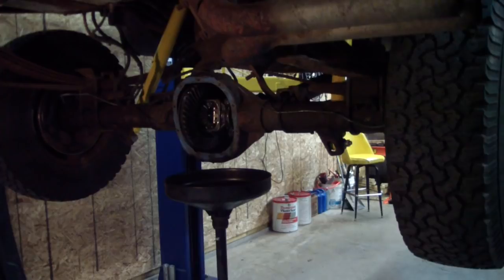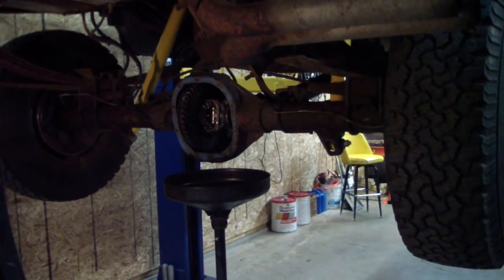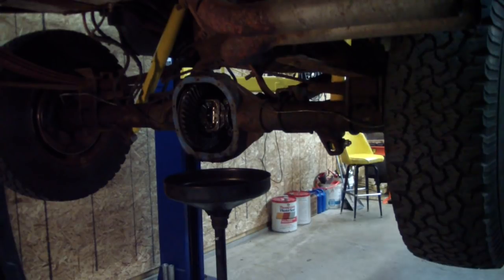While I'm in there I'm going to throw a couple axle bearings and seals in it as well. This rear end I'm working on is a Ford 8.8 with a 31 spline axle, and I found that you have to take the rim off to be able to push the axle in far enough to get the c-clip out.